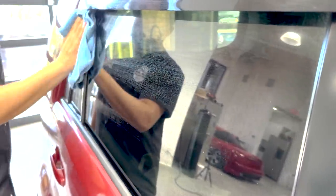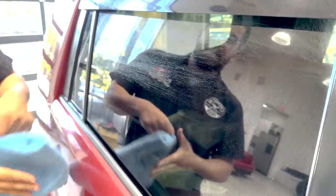Whenever you do polish, you want to make sure the surface is clean and fully prepped. Not much of a difference in terms of the water spots yet, but we're definitely in a better position than we were before, simply because this is nice and smooth, and we can polish it without any contaminants getting on our pad, on the machine, and then scratching up the glass.